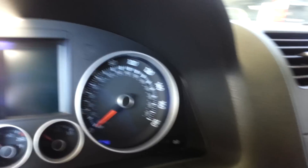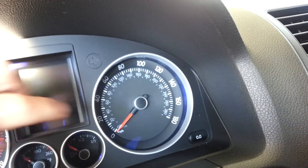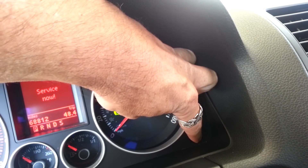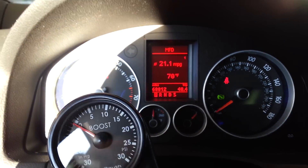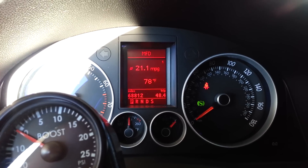You don't have to start it — you're just going to turn it from this position to the upright position. I'm not going to turn the engine on, just turn it to the upright position. So now, with my free hand, I'm going to hold the button in, turn it to the on position, and then press the minute button once. And that's what it did — it went to Volkswagen system and I believe it reset it, so I can go another 5,000.